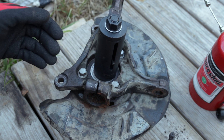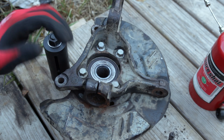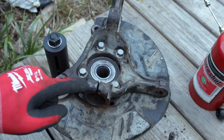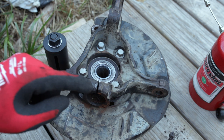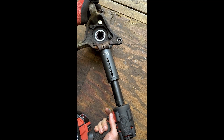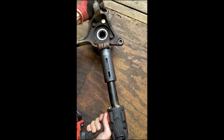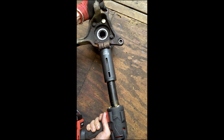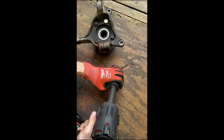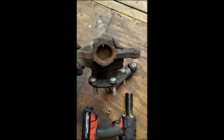I'm going to go ahead and do the other ball joint just to show you a second shot. I need to get pinch bolts — I might as well get a second pinch bolt for that knuckle, because I know it's going to snap off since both of them look just as crusty. So go ahead and start on that one — throw your impact on there and let her eat. And out comes that rusty, disgusting Subaru ball joint that's notorious for rotting into the knuckle.